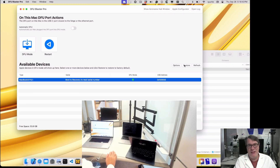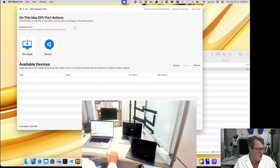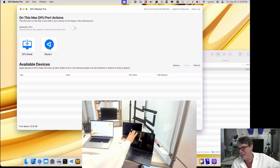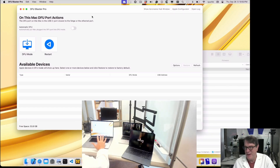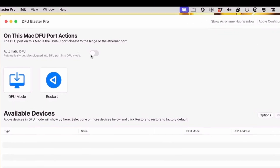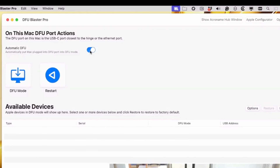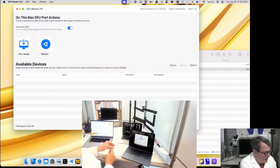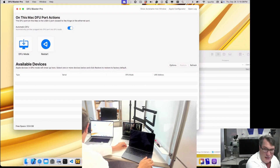We can do better — that's scenario two. We can do up to three or maybe four machines at once. Let me show you how. We're back to the same scenario with these two target Macs in whatever state and DFU Blaster on the admin Mac. Now I'll use the next feature called Automatic DFU. I'll select Automatic DFU — what that does is when I plug a USB-C cable into the DFU port on a target Mac, whatever Mac I plug this cable into will automatically go into DFU mode. It's a very powerful feature. I'll plug it into this first one's DFU port — as soon as I plug it in, it goes into DFU mode.